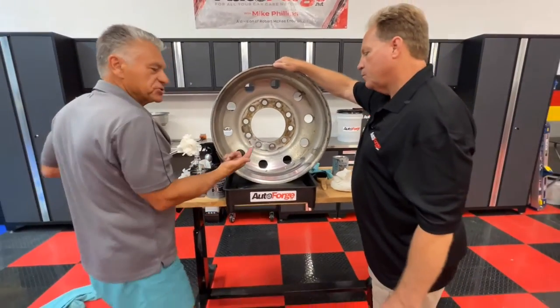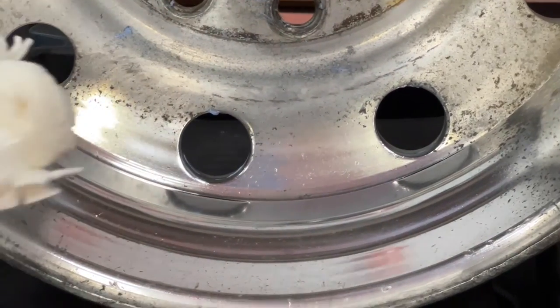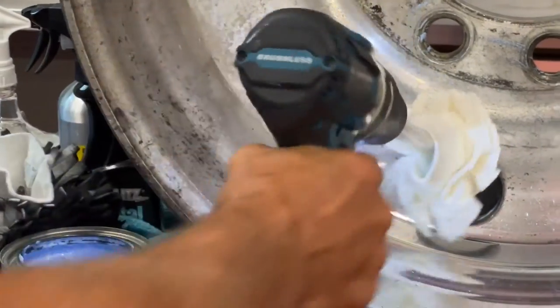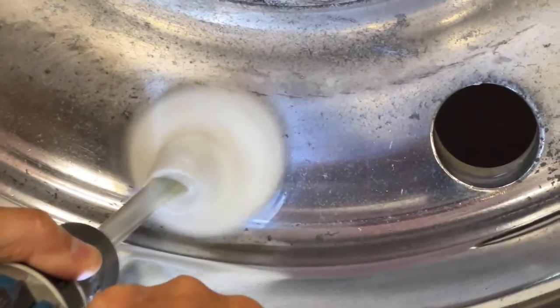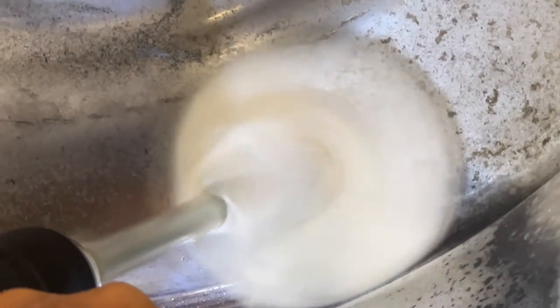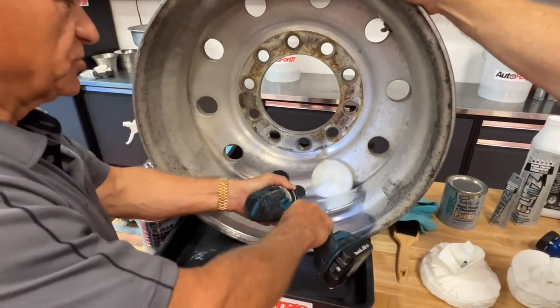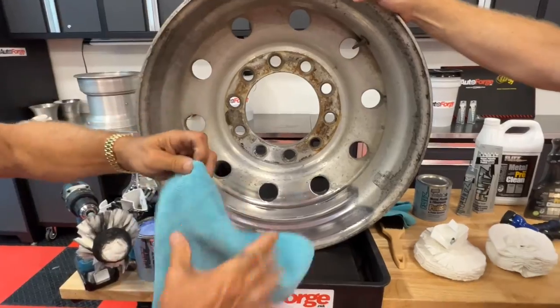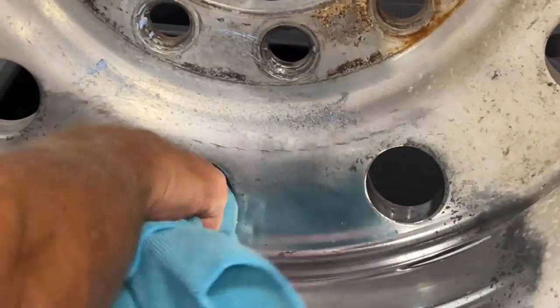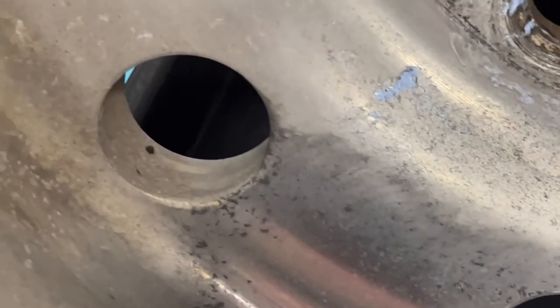What we're going to do in this case is take a little Flitz Polish, smear it in a hole, and let the buff ball do the rest of the work. This is a two-inch buff ball. If you notice how these fins come up, we sell a lot of these for motorcycles, for spokes and hard-to-get-in areas. But on a truck wheel like this, we just kind of work it. Wow, look at that — it doesn't take a lot of effort. It just collapses and sits inside. It'll actually conform to whatever you're trying to clean. That's a lot better than fingers pushing an old rag. Once I've done this and gotten it to a real high finish, I'm going to take a microfiber and wipe off the residue. See how this comes out — nice and polished. We do rod holders in boats — if you go fishing, you know how the buildup gets in there. Engine casings on a bike. Anything hard to get at.